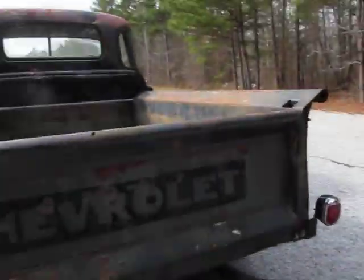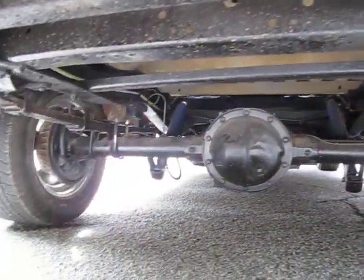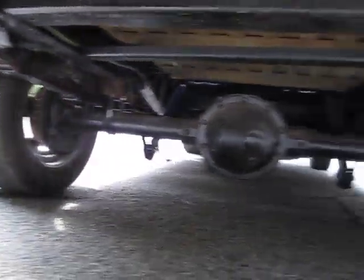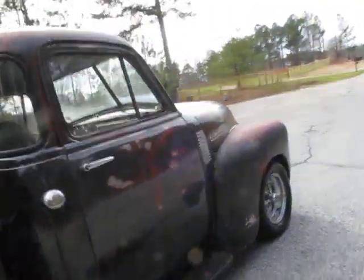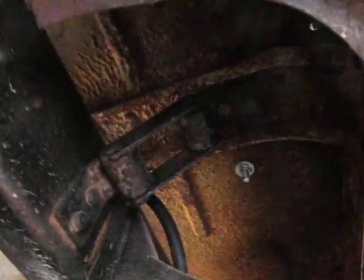I know that the lights work. Not sure that it's got turn signals. There's your rear end, frame rails, everything under here. Looks like it was undercoated many years ago, and it's all still nice and clean. Step sides, I mean, this is such minimal rust. These spots that I'm pointing out, for example, it looks like there's a little bit of rust on this side of the cab corner. There's a hole right there. The other cab corner appears to have been replaced.